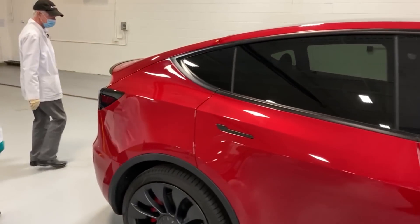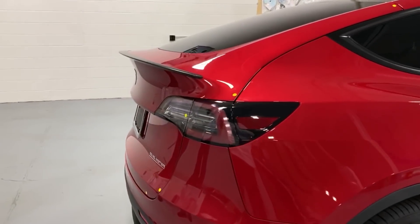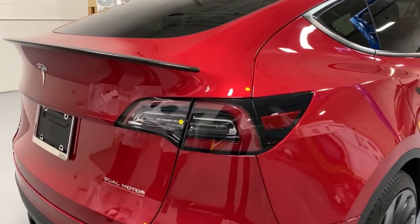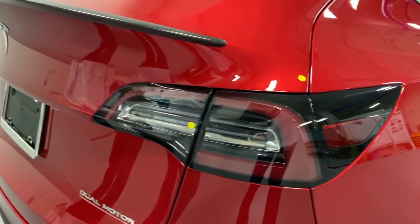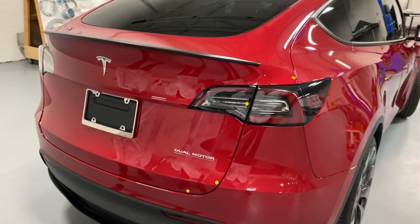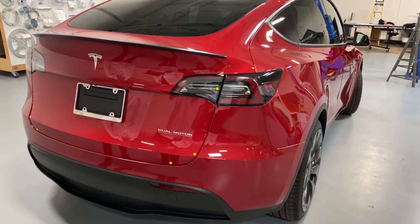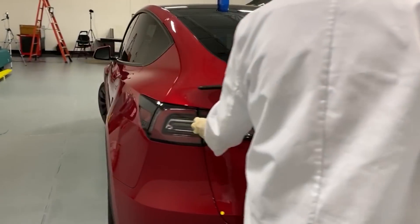The rear of the car — this is where the biggest gaps were, all the way around. Normally we would like to see left to right the same, but unfortunately on here we're looking at one and a half to one millimeter gaps that are differential. And then the biggest one was the tail lamp to the body at the lift gate. That one there is out the most — three and a half on one side and six on the other. I can barely stick my fingers in on this side.